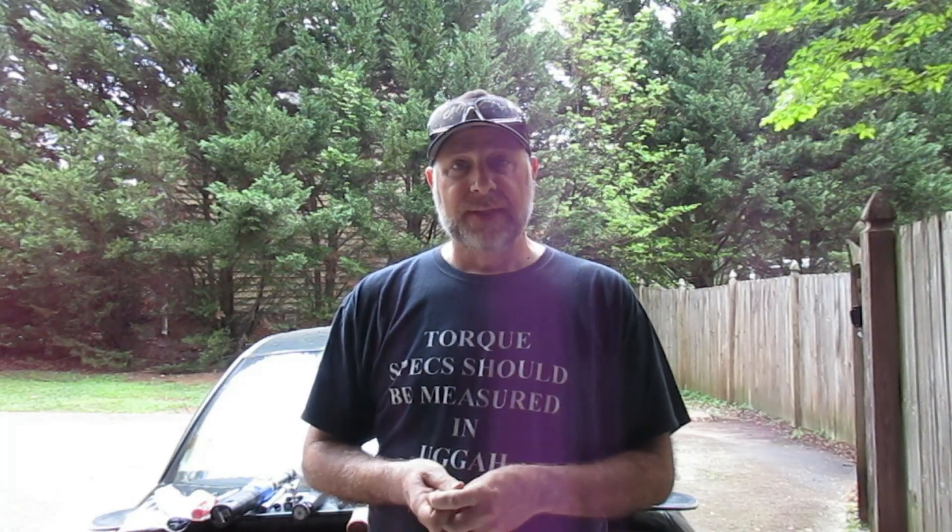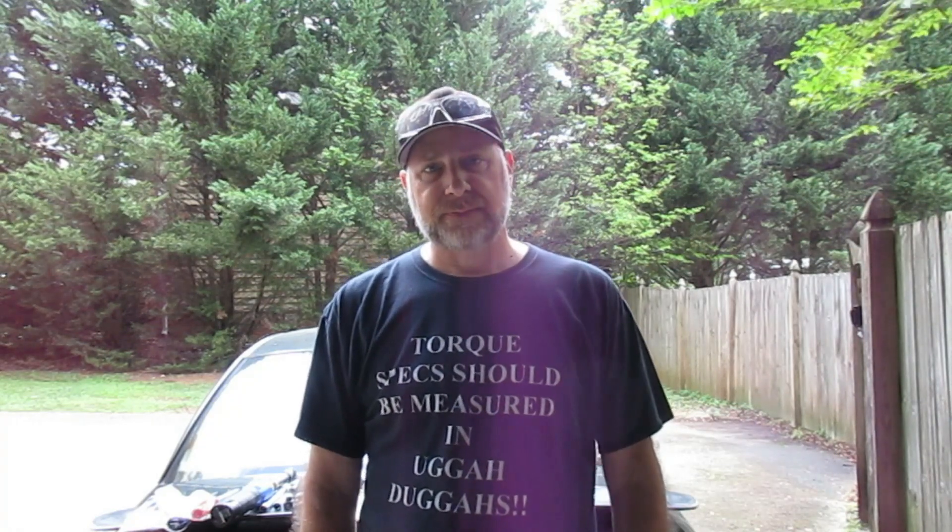I have a jack and I'm going to jack the car up and put it on ramps. I'm not going to show that on camera, but that's just a personal preference — anytime I'm working underneath the car and I'm not working on wheels or brakes, I like putting it on ramps. To me it's more secure and I feel more comfortable. I've also got wheel chocks up front. There's no sense in showing it on camera, I'm just going to jack it up and put the ramps underneath.